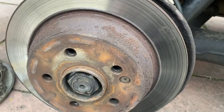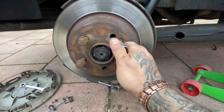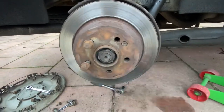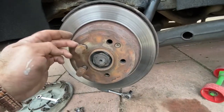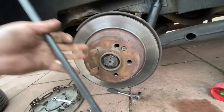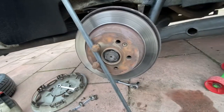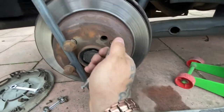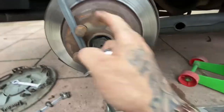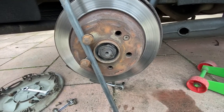Let's take this off and see what's inside. Here's a little top tip: when taking this bolt out with the hexagon head, sometimes it will turn the disc. Some people say you should do it before everything else. I found an easy way - put two of the lug bolts back in and use a bar for resistance. There you go - no resistance now. That's how I get this little nut out, which is what holds your disc on.